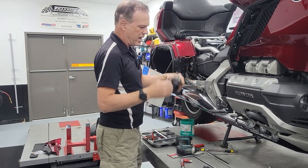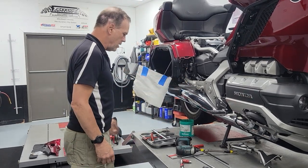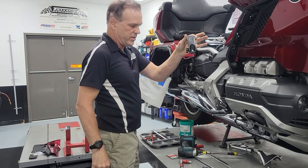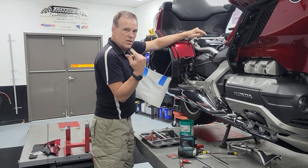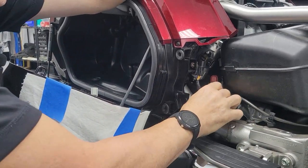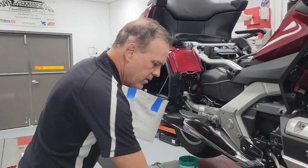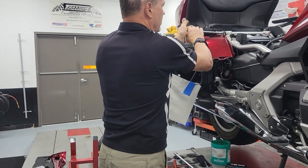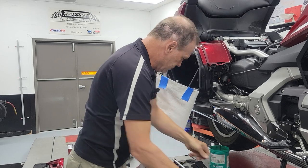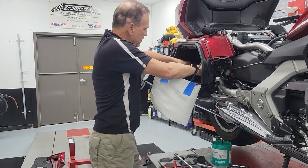There's a 10-millimeter headed bolt inside here, and you do have to force the plate off a little bit. If you ever wondered what that plate was, that's your permanent VIN stamp in the frame — it's under there. You'll want to remove the bracket that holds the gas tank — again a 10-millimeter head bolt, that's all there is to that. There's an electrical connector here you'll need to remove; this is the sending unit that tells the bike whether you're one-up, two-up, or wherever. Next, we're going to unbolt the saddlebag — not remove it, just unbolt it. There's an 8-millimeter headed bolt up here at the top (which is why you had to remove the grab rail), and then three bolts inside the saddlebag using a 5-millimeter Allen key — two are on the floor and one is on the back wall.